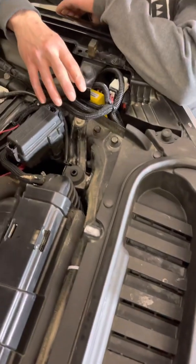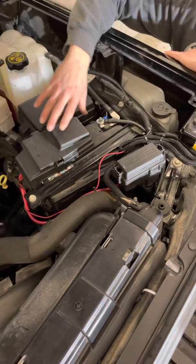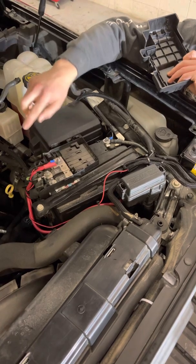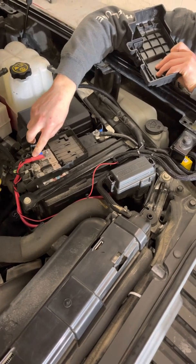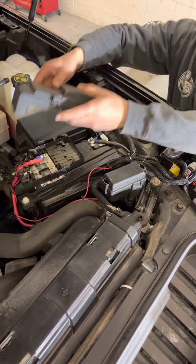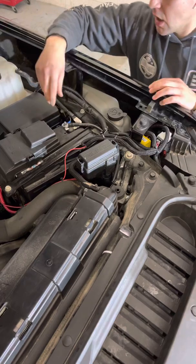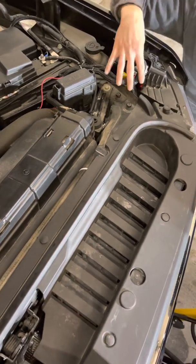Moving over here, I'll show you how we tied in that ESS system — this was a little bit of a complex installation. Underneath the positive battery post protective cover you have your 12 volts DC and your sensing 12 volts — one for your controller and one for main power on the plow itself. This runs down and in behind where we've hidden the 250-amp fuse underneath the vehicle factory fuse box, and there's also an inline relay for the controller system. That's all hidden up, tied off nicely. Our controller cable is being run down through the firewall and into the cab.